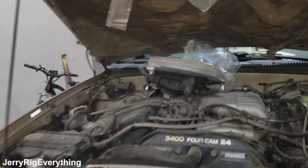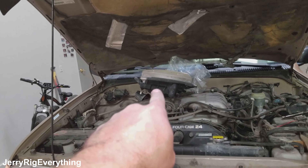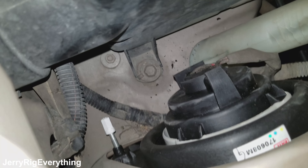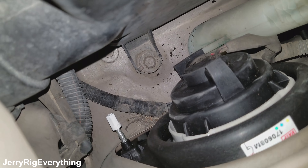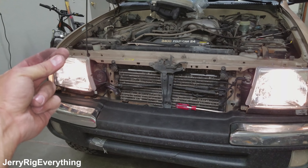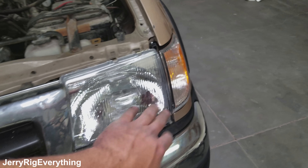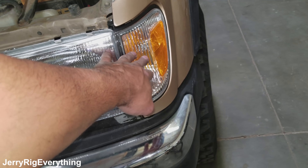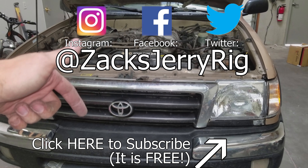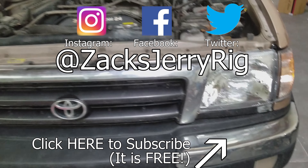Luckily these are plastic so I can just toss them in the recycling bin — I don't need them anymore. I am going to take the bulbs out just in case I need those though. On this one with the light adjustment, the little knobs have caps on them which makes it a bit easier to adjust — just stick a screwdriver in the end and you can twist it. Now I'll put the grill back in. And that is how to replace the headlight and the side light in your 1998 Toyota Tacoma. If you have any questions, leave them in the comments. Don't forget to like this video if it helped you, subscribe, and thanks so much for watching.